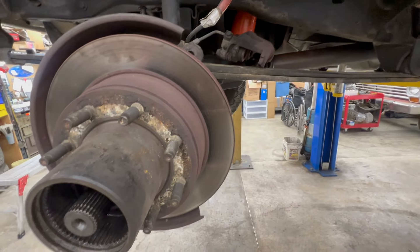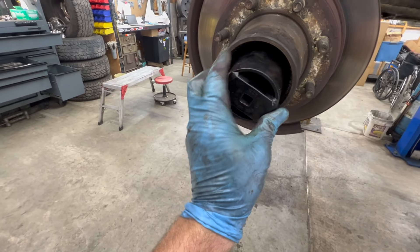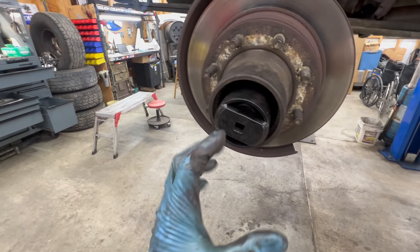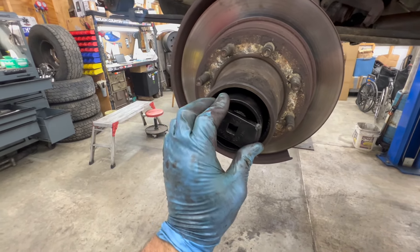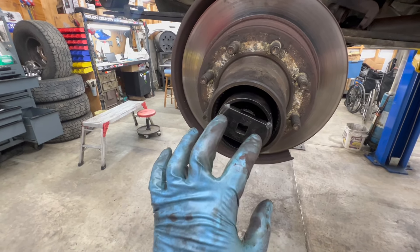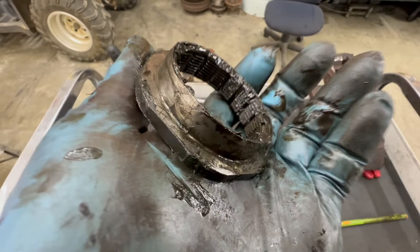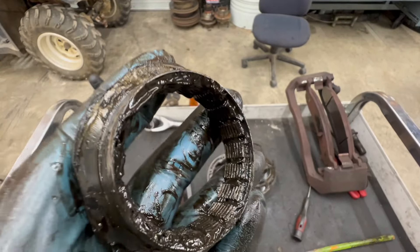Calipers are all removed, so now we can get back to removing this nut. It's a two-and-three-quarter inch socket that you need — this is more specific to 1995 to 1997. And once again this kind of depends on your hub setup — you may have the two locking nuts with the little splined washers that go in with the tabs that line up with each other, which is a whole different setup. This is a two-and-three-quarter here, so I'm going to break this loose. This is not an impact socket style, so don't use an impact on this style of socket because you will quickly ruin it. Here is the axle nut — you can see it's not really your normal hex shape nut, it has grooves cut into it.